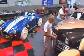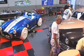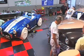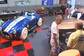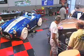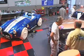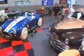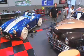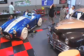I actually had a guy ask me about that recently. He says, I never reduce my pressure. And I says, well, as you're buffing out the paint, you have spent product, that's the product's used up. You have paint particles you pulled off. And if you don't lessen up your pressure, you're pushing all that into the paint. You shove it in there. And that's where you get into a term called jeweling. And the jeweling process, a lot of guys only use the rotary with it.